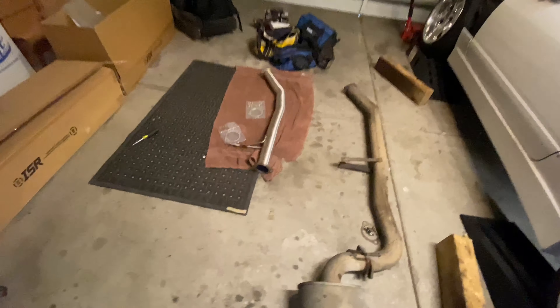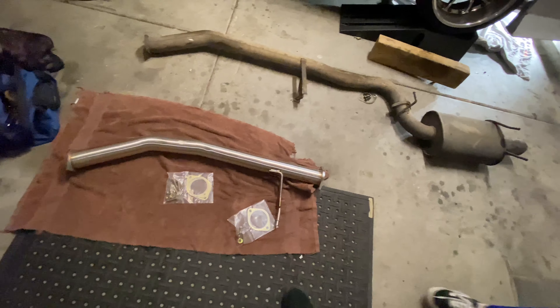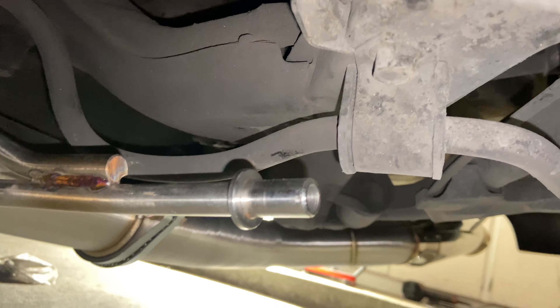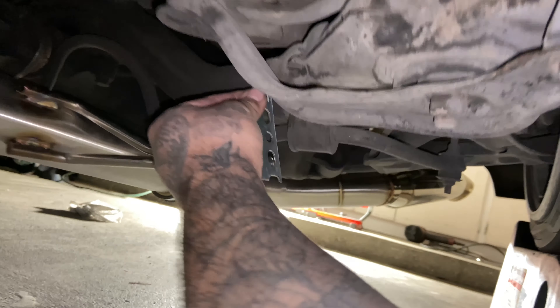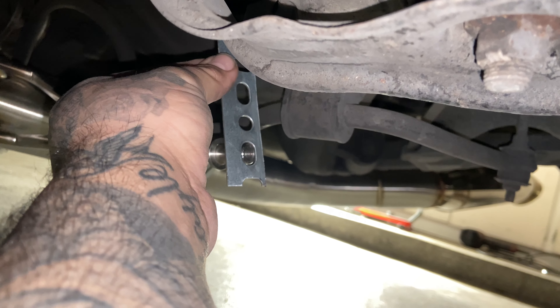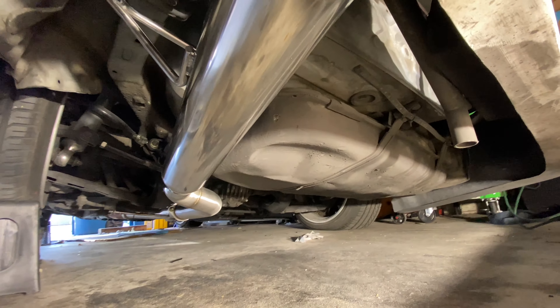Now I'm going to work on the mid-section. Figure out this weird mount. I got the exhaust loosely hanging up here. The only thing with this kit is it's got this weird mount, and the mount is where that original hole is. So what I've done is made a little bracket out of some metal — going to bolt that just like that, and that is our new exhaust hanger. That whole exhaust system is mounted up in there.